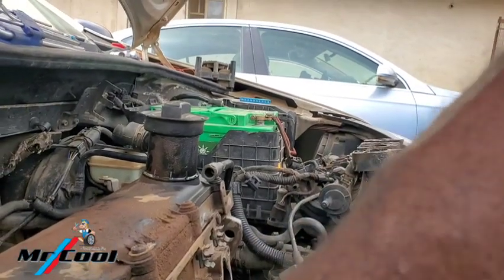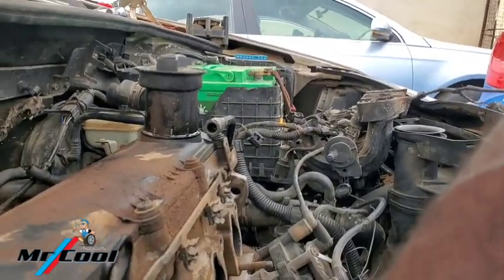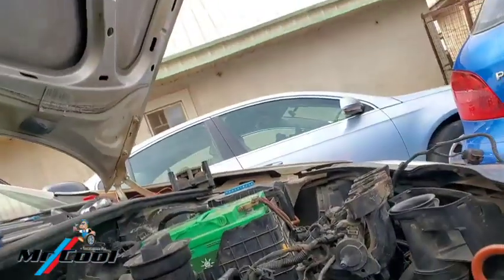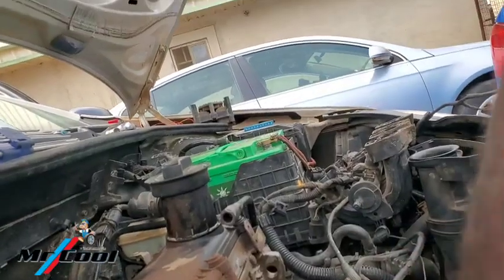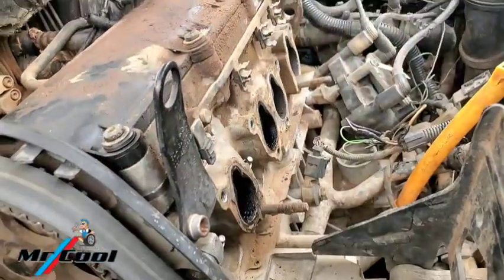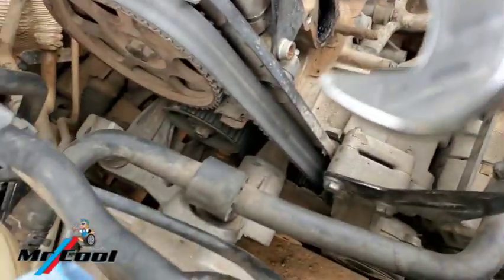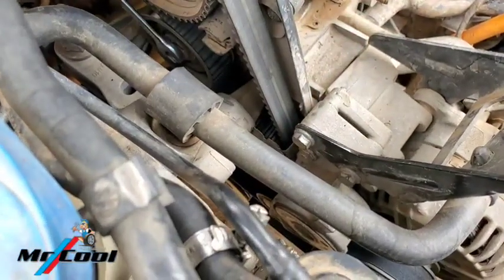And don't forget, now, before you lose it, here you see how slack the belt is, just like about 6 millimeter from this notch here. So you wanna set it that way when you're tensioning this guy right here. So the next thing to do is to find the pin socket. That looks like 13, but one way to find out is actually 14. So no, it's 13, and this is 12. So we go over here and backward. Don't over torque it when you're doing it.